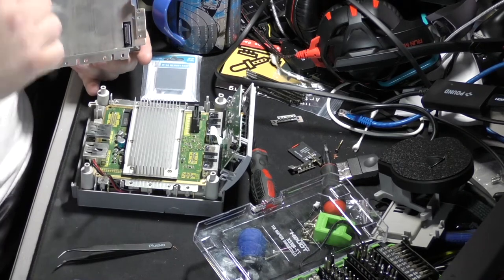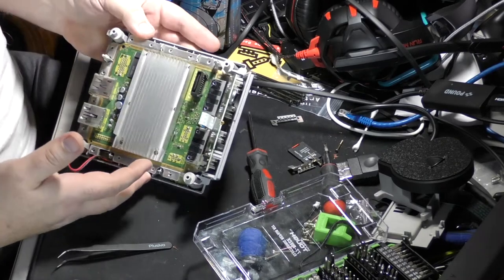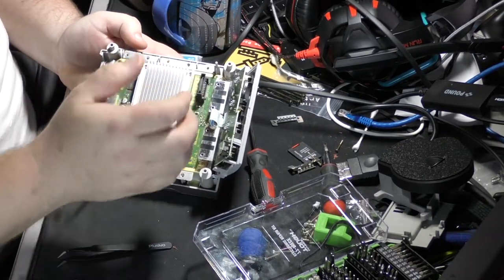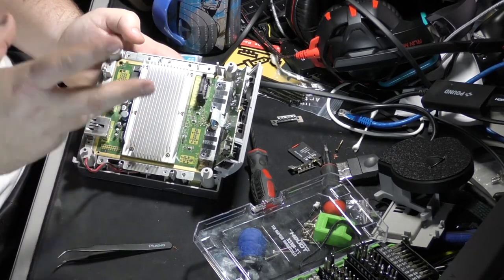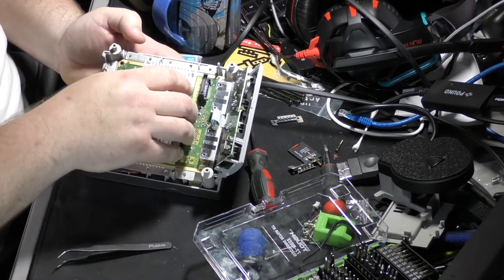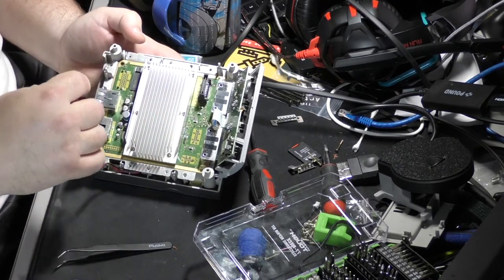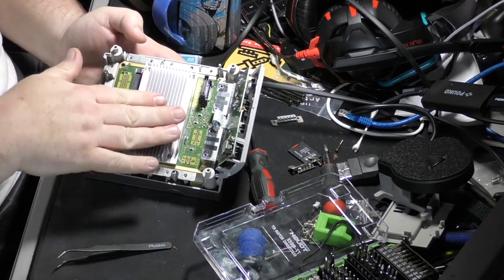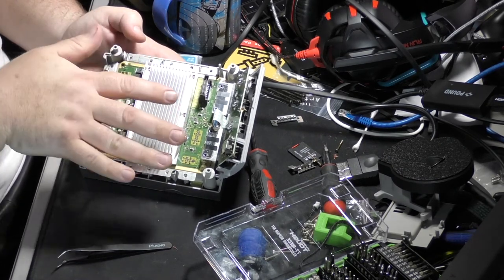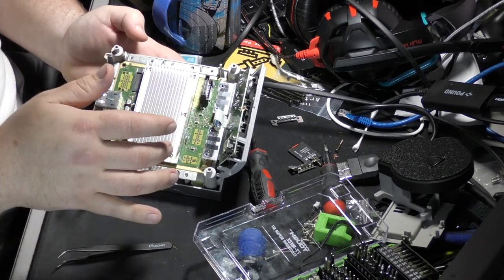And like I said earlier about the heat sink, the heat sink is literally six screws, Phillips head. Unscrew them, work it a little bit, get it off, because that thermal compound is going to be caked in there and dry. You just wiggle it until you get it to come off, get some alcohol, paper towel, Q-tips, until you get it all off of the heat sink and all off of the processor. The processor and GPU are both here. And then you make sure, processor, GPU, and two sticks of RAM, I'm pretty sure.